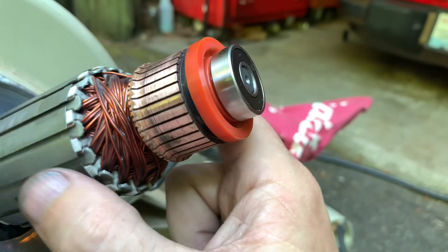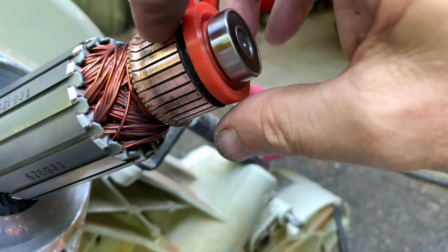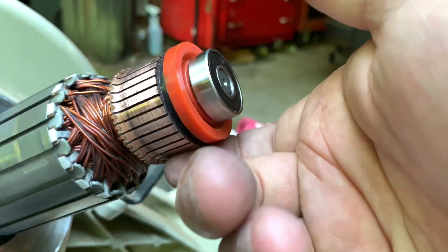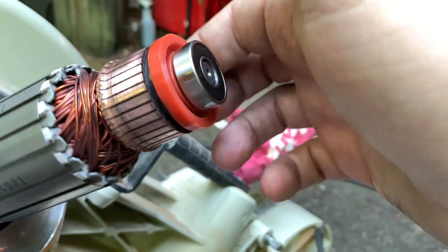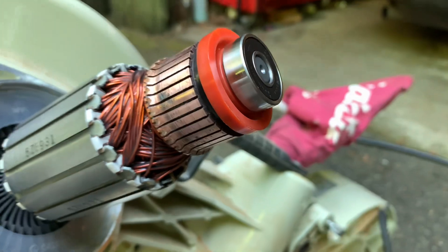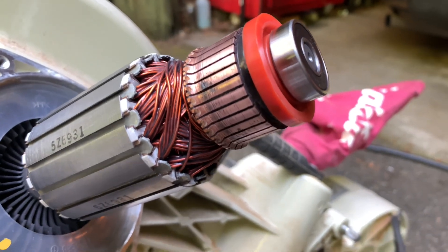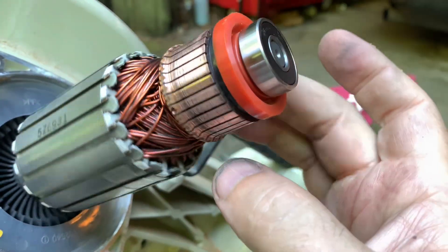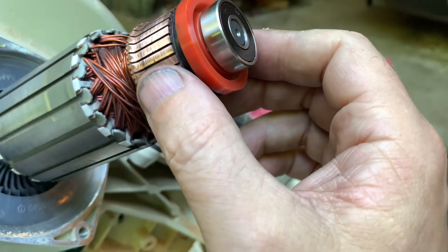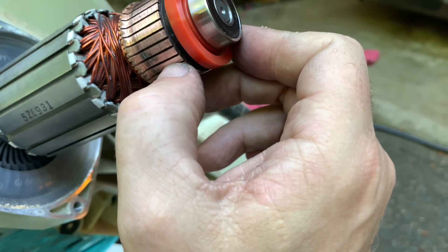You can see there's a rough spot here. And then if we turn 180, there's no more rough spots. So it's really just this one area here, and that's still just carbon. I'm going to keep spinning it with the sandpaper with 1000 grit until it's all shiny. And then I'm going to use my bamboo skewer and clean out in between these plates.